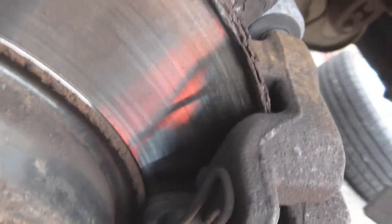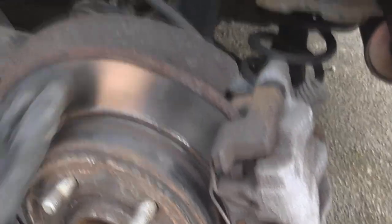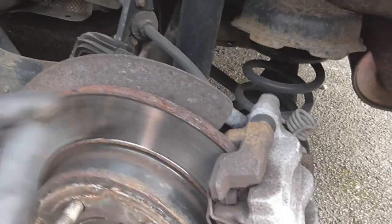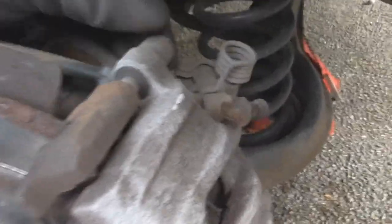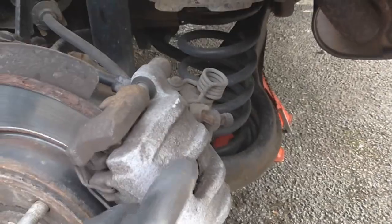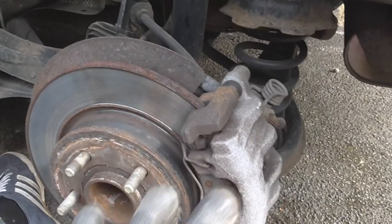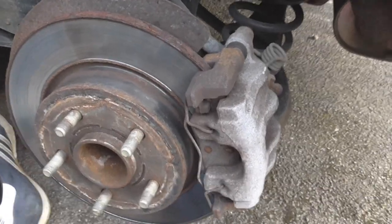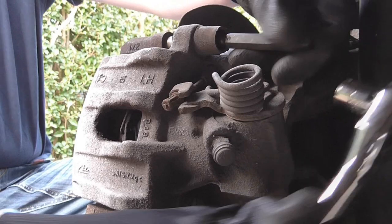Here we have a close-up of the brakes. There's a little bit of life left in the pads, but the disc itself is quite warped. When braking you can feel a little bit of juddering in the pedal because these discs have a really good lip on both sides. So we need to: take the caps off the back, undo the caliper bolts, take the pads off, get to the carrier bolts, remove the carrier, and get the disc off. The caps just pull off and reveal a 7mm Allen key — just loosen them off like that.